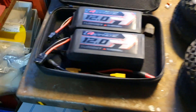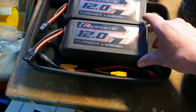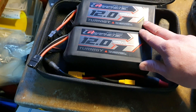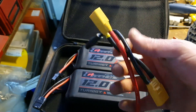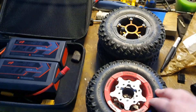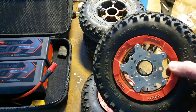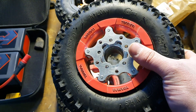So this is what I bought right here. I got two of these 6S 12 amp-hour Turnigy Graphene 15C batteries that I'm going to hook up in series for 12S. They will still be able to deliver 180 amps according to the stats, so that should be enough. I made this serial connector with the AS150. I also got the 8-inch tires that I normally use in the front wheels, some spare superstars, and hub adapters from Etox so that I don't have to remove the hub adapters from the other wheels every time I change these wheels.